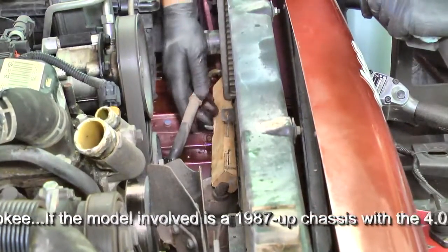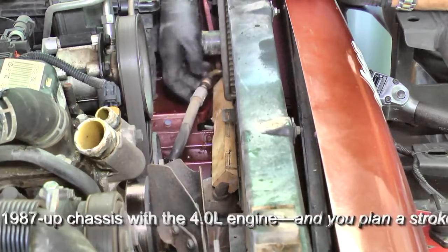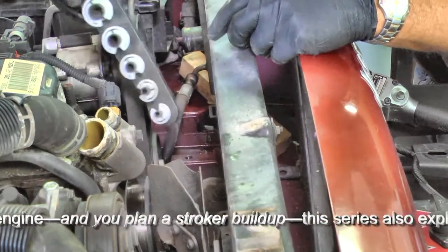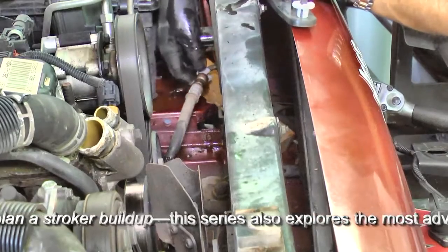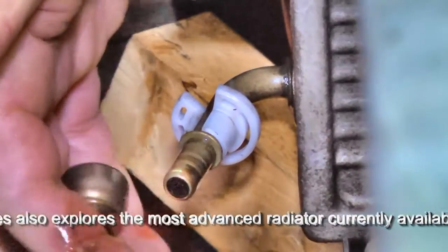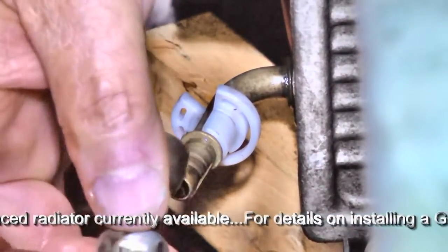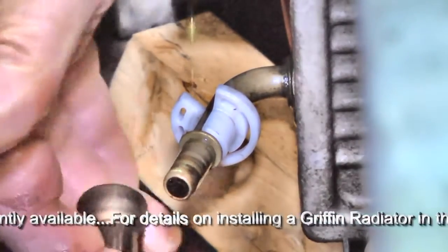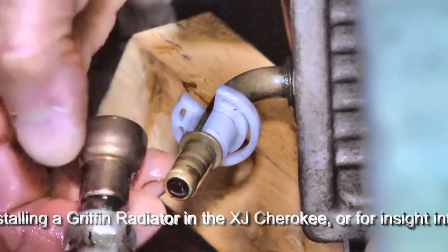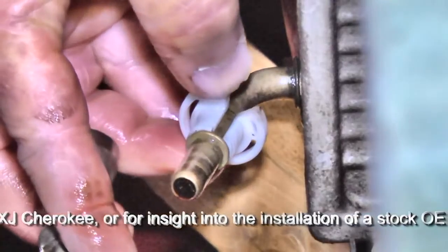With a block of wood supporting this side of the radiator, I now have access to this hose and can use a coupler tool to uncouple the hose from the radiator. You can use the factory tool or go aftermarket — this is readily available at auto supply stores and comes in assorted sizes for different couplers. With the correct tool in place, simply push the tool inward to release the spring. The tool slides in and releases the spring inside the hose, allowing the hose to slide off the end of the elbow. It takes two seconds if you use the tool; you'll damage both the coupler and this tube if you fail to use the proper removal tool. Very inexpensive — buy the tool.